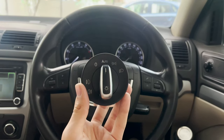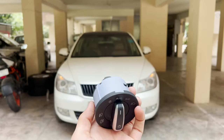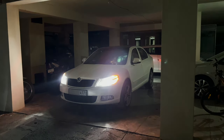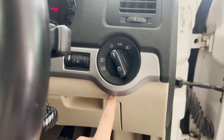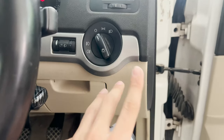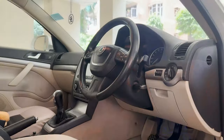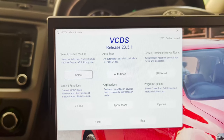Hey, it's Prerag and in this video we're installing an auto headlight switch in my 2010 Laura. This is the switch the car comes with and we will be replacing it with the auto headlight switch. The car has wiring mostly laid out, we just need to add one repair wire and it's very easy. We need really basic tools: a trim remover tool, a T20 bit screwdriver, one repair wire, and anything to code the BCM — VCDS or OBD11 both work.